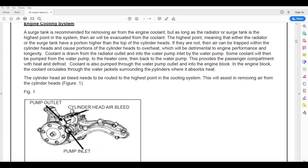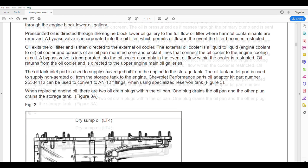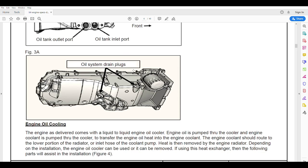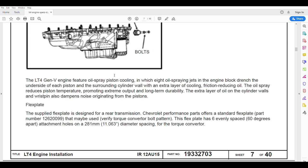The cooling system in these engines is just phenomenal. Here's the engine oil pump — there are a couple of oil pumps as I described. Anything over 87 PSI triggers a pressure relief valve. There's a primary pump and a secondary pump, and they're doing that for efficiency. The oiling system in these engines is not simple anymore — they've taken it to the next level. Keeping an engine like this alive with over 600 horsepower on pump gas, driving it every day with 10 to 1 compression and 9.7 pounds of boost requires a pretty robust oiling system. The GM engineers have done their job — these engines are out there in production vehicles running on the track and holding together.